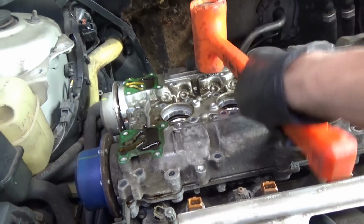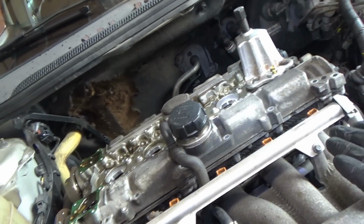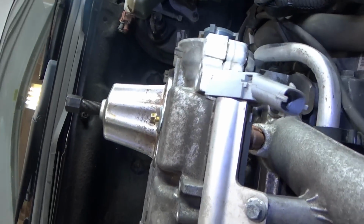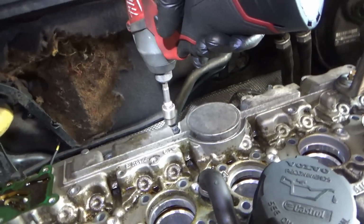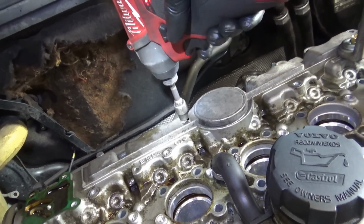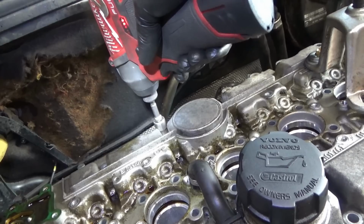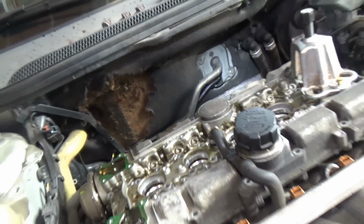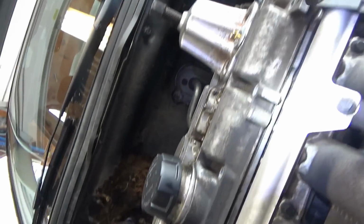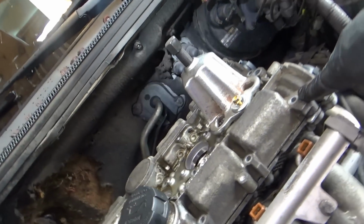hammered this side down, and look, that side came up. It needs to come up evenly. That's the whole key here. You see, this dowel is still frozen. So what I want to do is help this thing out. Screw two bolts back in, just partially. Okay, and now, oh, it's closed. So this dowel is the only one that's stuck.